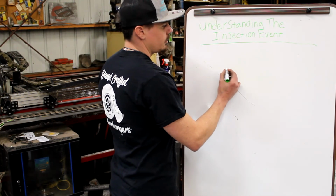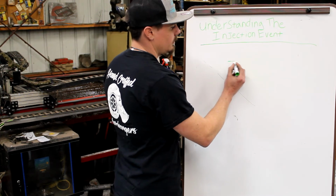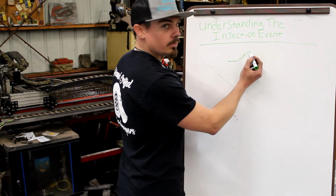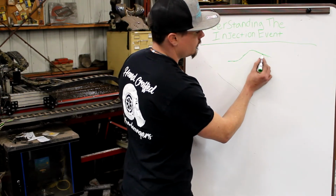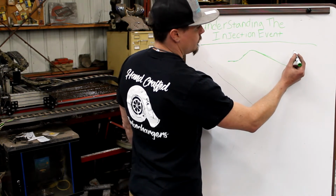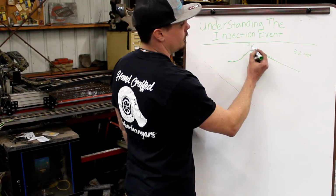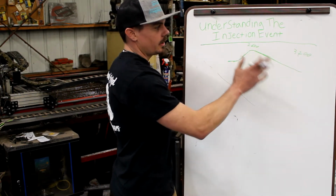It has a fuel rate curve. And VEs kind of tend to do this. They start off actually pretty decent, and then they will come up, and then they'll hit an RPM where their refill time and the plunger system gets too short, and they do this. So the RPM is going up, but the CC rate is going down, even though the governor, say we put 3,200 gov springs in it, and this is 3,200, we still have less fuel here than we did at 2,600 RPMs.